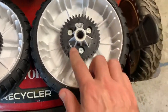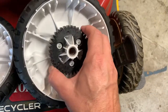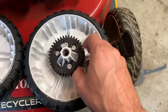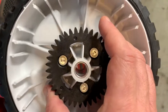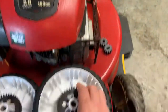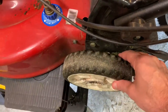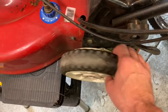It's almost an exact replacement but there's one change — this drive gear, cog gear, whatever you want to call it, it looks like it's glass-reinforced fiber or something. The old one's metal steel, and I have a bad feeling the replacement might not last as long — but then again it could be a design upgrade. These old ones, this mower is 10 years old, and the failure inside is pretty tragic.